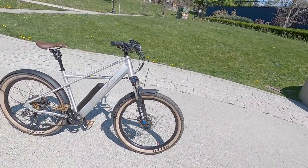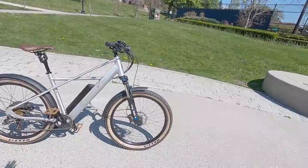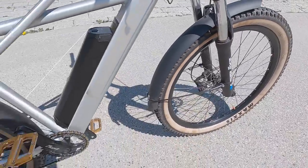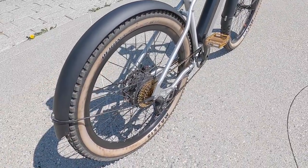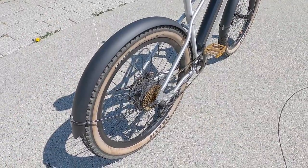The fork is not frame-matched — the frame is silver brushed aluminum while the fork is black, as are most other components including the rims, spokes, hubs, and motor. The motor itself is pretty nice: this is the Bafang 500/750 watt planetary geared hub motor with 65 Newton meters of peak torque — same as the Shred. These bikes are fairly capable as far as hub motor e-bikes go, and you get a throttle, which you don't see a lot on mid-drive electric bikes.